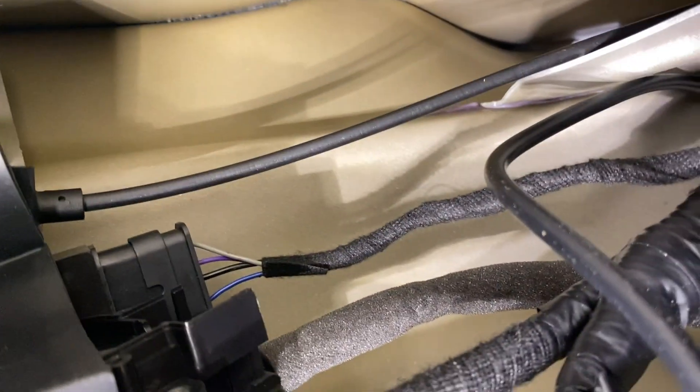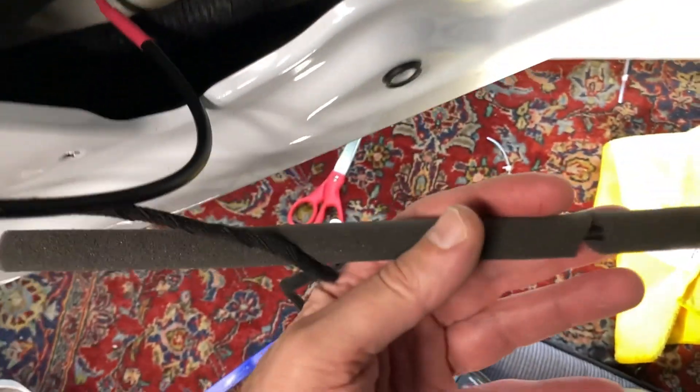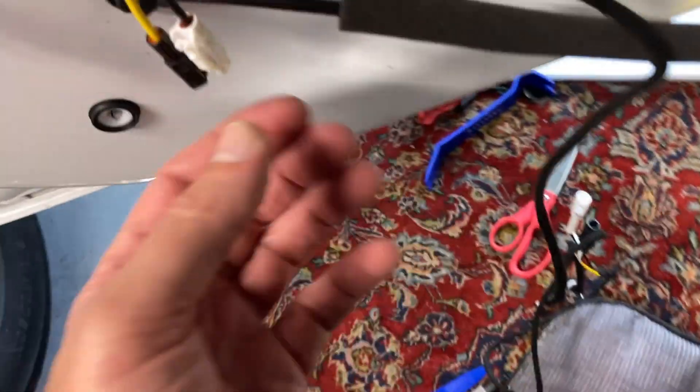When you route the cable for the motor, make sure it's sitting in the bottom with a nice run — going straight up in there like that. That's the motor cable down here that runs right up like that. There shouldn't be any kinks in it because that cable gets actuated every time you open the door — this motor kicks and pulls the cable, releasing the latch. You don't want to route it up and over and back down. Keep it on a nice smooth run.